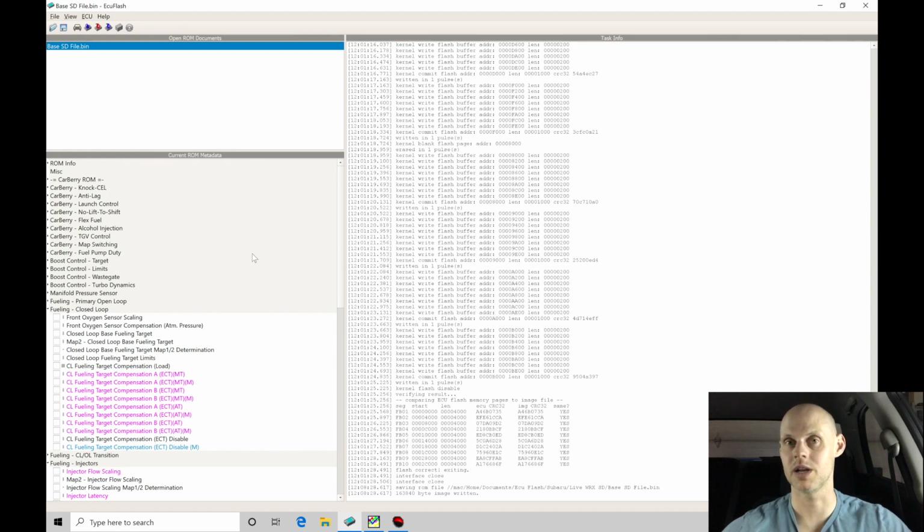Now, anytime you get an engine starting to calibrate and tune, and you're starting off fresh like this, where you built the map and you get it up and running, we don't want to immediately go after making changes to the MAF curve or, if you're in speed density mode, the volumetric efficiency table. When the engine is cold, we have modifiers being applied to it. We have both post-start and warm-up enrichment. We need to make sure that those have dissipated and are no longer adding additional fuel, because the warm-up and post-start add additional fuel against the base pulse width that's calculated from our air mass and fuel mass relationship.